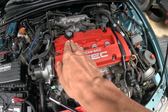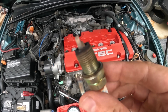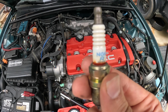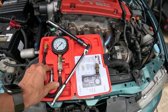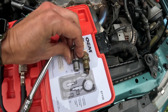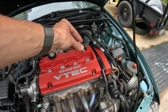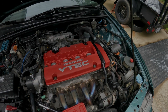I went ahead and removed all four spark plugs and put them in front of the camera so you can see. Here's a close-up — a little fouled up but not too bad. I do see a little rust spot where the intersection of the ceramic meets the metal. Now let's get this compression tester set up for a Honda motor. I'll take this adapter, put it side by side with the spark plug — those threads look identical — then attach the adapter to the end of the compression tester and thread it into the first spark plug hole.